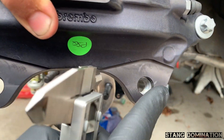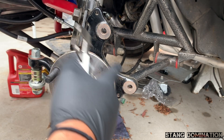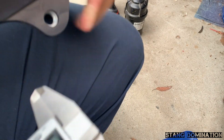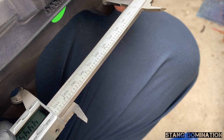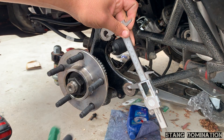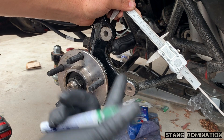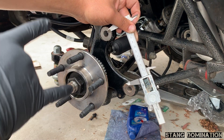What I'm measuring is from the inside of this hole to the inside of this hole — the distance from hole to hole and what the difference is between the two sides. The other side didn't line up correctly, and I'm pretty sure it wasn't my fault. Make sure you don't hit the threads, just hit the actual casing. I'm getting 4.445 on the inside and 5.622 on the outside. On the other side I drilled directly in the center of the circle and it wasn't aligned correctly — we're having the same issue on Isaac's car. These are not a direct bolt-on from '96 to '04.